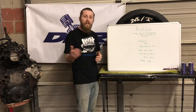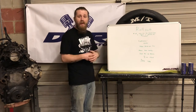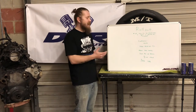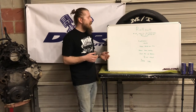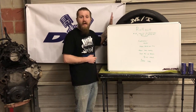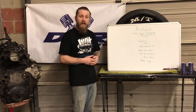For more information, Mickey Thompson has this on their website, including ways to correct rollout differences and a step-by-step guide on how to measure them. This has been just the bare basics to introduce you to the concept of rollout — what it is and why it's important when buying tires. Here at the shop, we don't necessarily measure the rollout of every tire that comes through, but we do check the rollout values written on the tire to make sure they match, and we check the condition to make sure one isn't much older than the other, since you will see that shrinking over time.